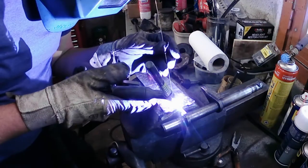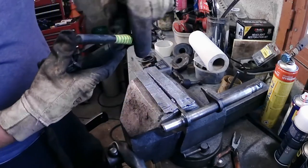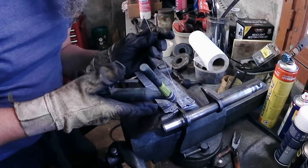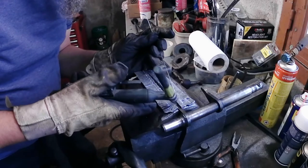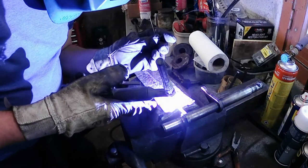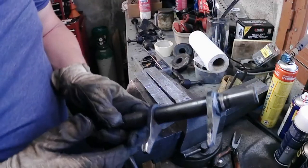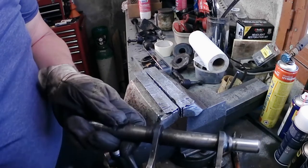I can recharge the tips with stainless steel without overheating the core metal too much. It may not be as hard as the original but it will work. Pretty good — doesn't look too overheated. We'll roll it up on the edges, then file it down. Not too much heat in the end of it, still got a bit more on that side.